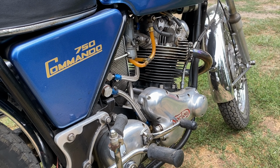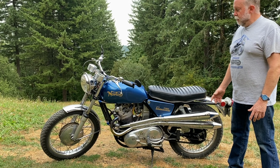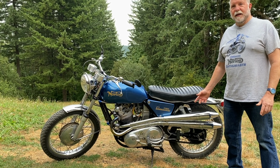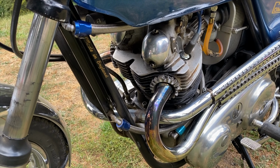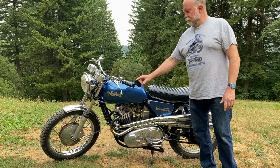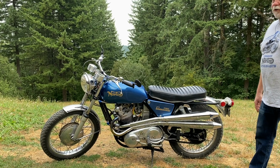When I did the engine on it, I got help from Portland engine rebuilders, Larson and King, and they did the balancing on it, and we put a Johnson cam in it, and I ported the head really well, and we did the 9.5-to-1, I think, Combat Commando pistons, and it runs pretty good. It's a great running bike. I got the cheap mirrors on it still. I'm going to switch those over to the other style, but they work, and they keep me legal.